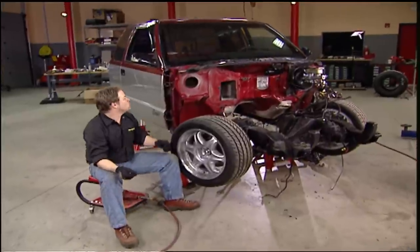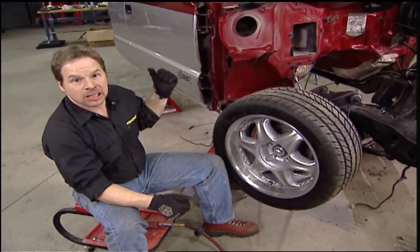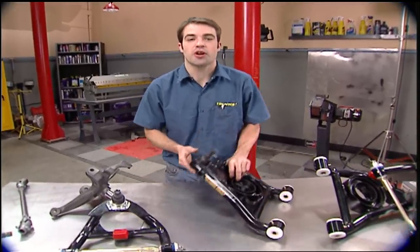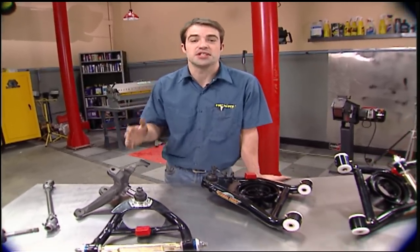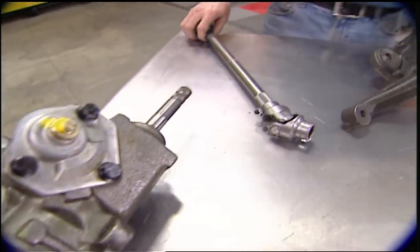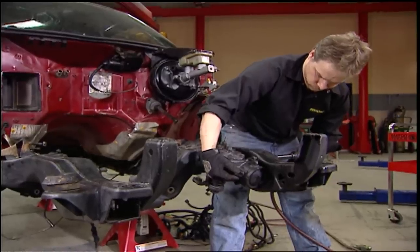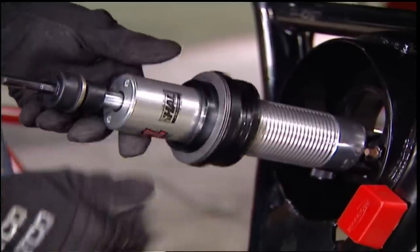Welcome back to Trucks. We've taken the plunge, transforming Project S10K from a capable little street truck into a mind-blowing pro street Jekyll and Hyde special. With our back half completely done and our new rear axle powder coated and fully assembled, now it's time to look at the front. The stock upper and lower control arms are very strong but also very heavy, so we're swapping them for tubular upper and lower control arms from Global West, along with Belltech two-inch drop spindles to help keep our front end out of the wind. The OE steering box is a power unit, but weight reduction is a big part of building a successful race truck — so we're ditching the power steering pump and replacing the factory box with a lighter manual box from Borgeson, using their spline shaft and U-joint system. Things like ABS sensors, the heavy anti-sway bar, and dust shields won't do us any good, so they'll hit the parts pile and save us weight — every little bit adds up. The Global West control arms are made for an S10 pickup, designed for coilover shocks to bolt right in, with the option to run with or without a sway bar.